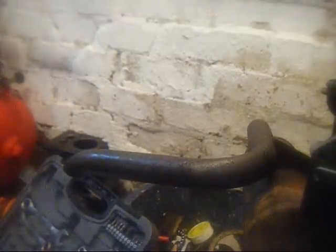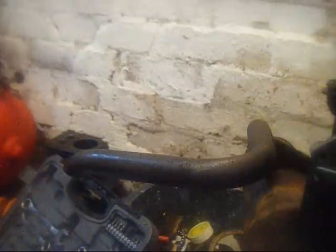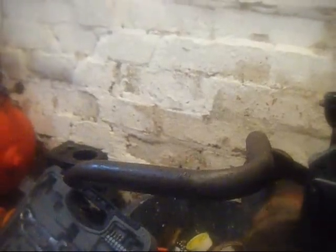I had to run it for a little while at low RPM and it burnt all the oil off — it stopped smoking and making horrible smells. I will, one day, show you how to get the flywheel off, but I need an air chisel because I can't get this one off at the moment. I've been whacking it with a hammer trying to get it off, which is not the best idea.